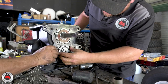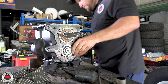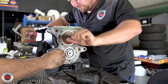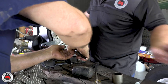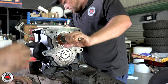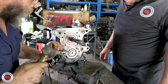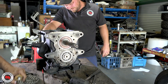This box must have been apart once before in its past life. The wear on it was quite telling - I think it's had a bit of a brutal life, especially with Simon owning it. Simon owned it and he did over 600,000 km and everybody's seen him jumping up and down those rock ledges in the Northern Territory - he bounced this thing all over the place. Making sure the lay shaft is knocked through enough so the circlip will go home. For people who like to keep their trucks forever, there's something to be said for using really good quality oil. The last 300,000 km Simon's been using nothing but Penrite oil - there was damage on the shafts, but considering it had really second-rate Taiwanese bearings and third-rate Simon jumping it through the air, that's pretty good.